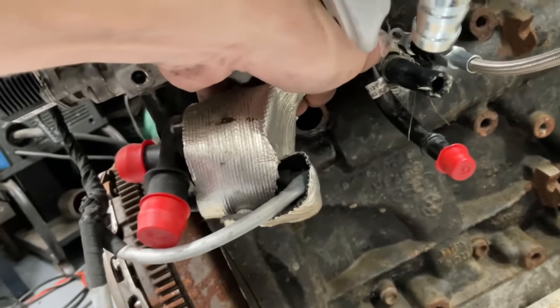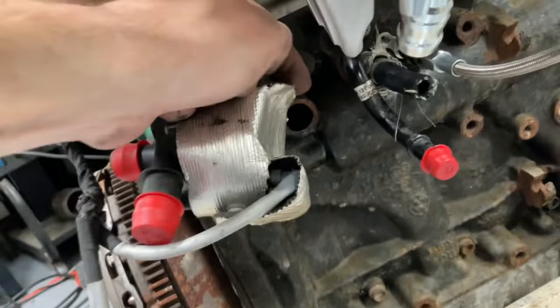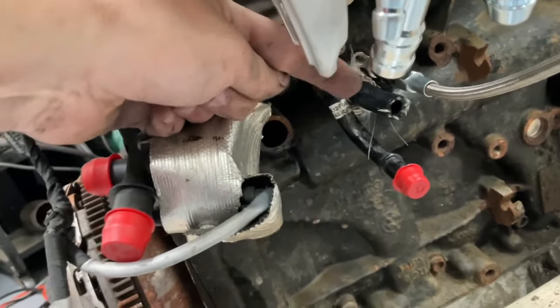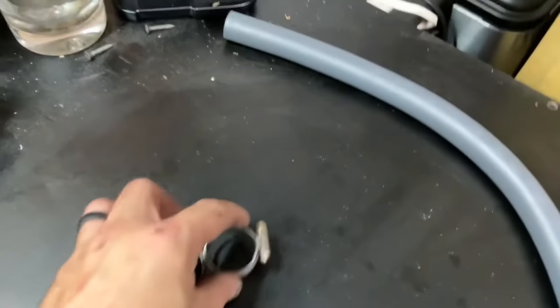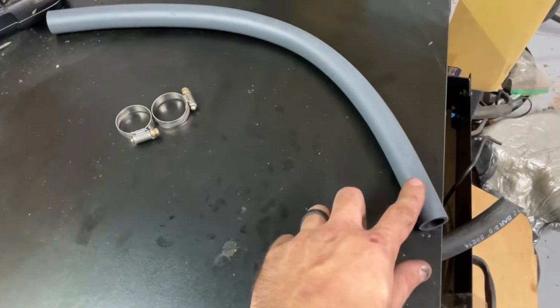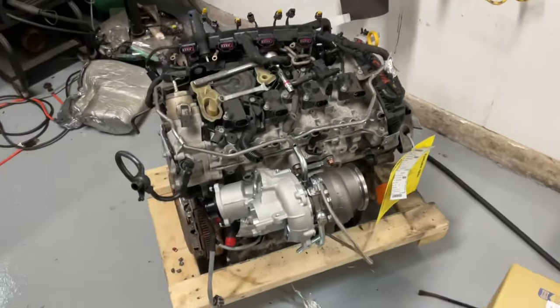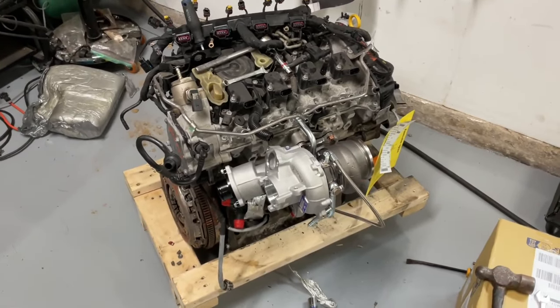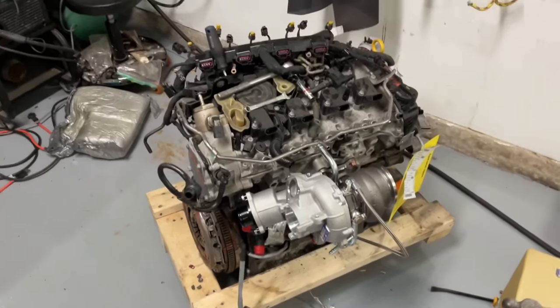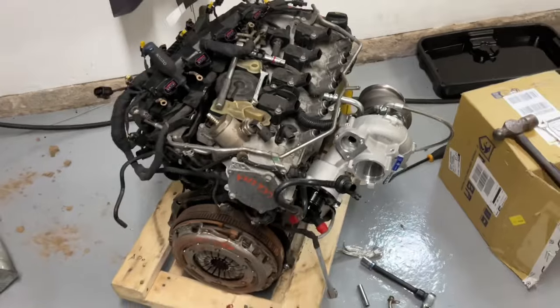The one thing I'm leaving out of this video — that spot right there is where the oil return tube is from the factory. When you pull the rubber hose off the factory line, you can reuse the metal tube already in the block. All you do is cut a piece of the rubber hose Mamba provided to the right length — measure from the tube on the turbo to the tube on the block — then clamp it on with the two supplied clamps. Very simple. You usually only end up using a couple inches of hose and there's plenty extra, so if you butcher the first cut it's no big deal. Any questions feel free to comment — I've done multiple of these installs, most of them in cars. This is the first one I've done outside the car for display purposes. Thanks for watching.